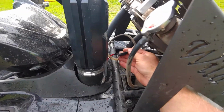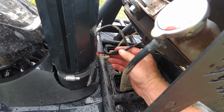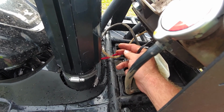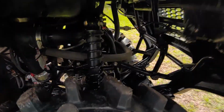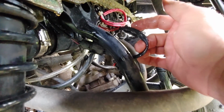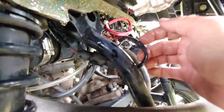When you move it, obviously you're going to have to splice the fan wire here. Now I decided to splice it up here, and then I had some, I believe that was 14 gauge wire. Ran enough, and then what I did was, right here is the actual plug. I cut it about that far, and then spliced all my wire. Gave me plenty of wire. That's the plug. Plugged it in, then come off a few inches, spliced it in, and then ran it up.